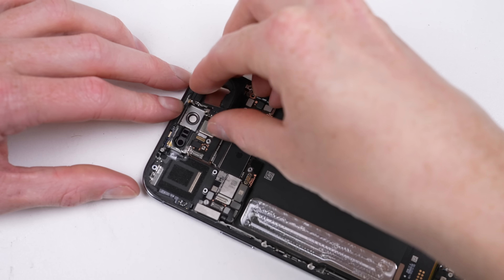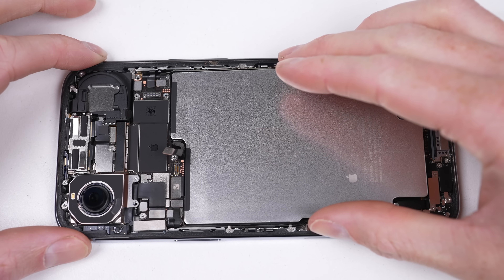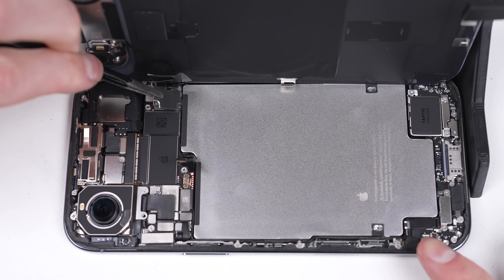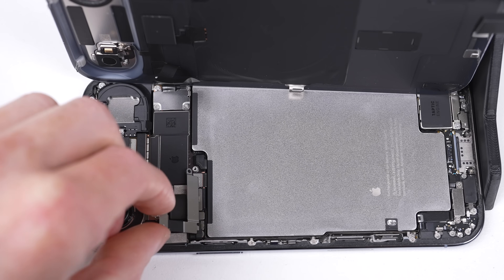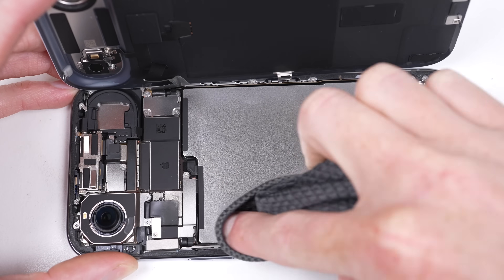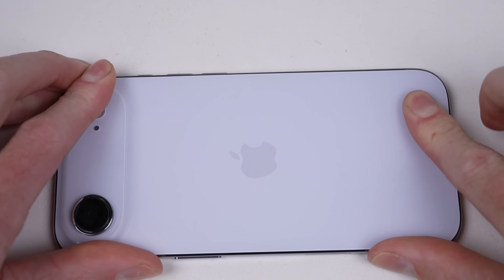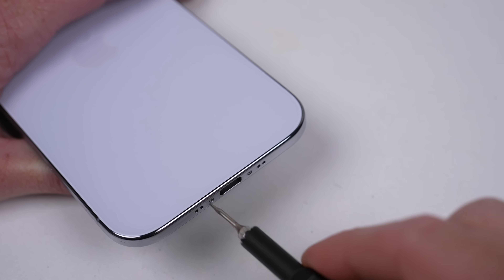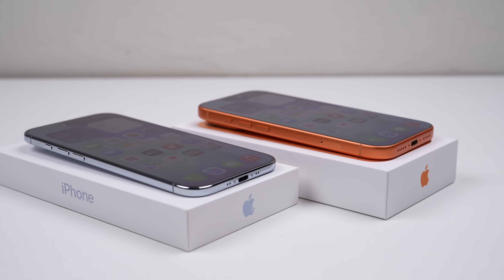With the 17 Pro back together, all that's left is the iPhone Air. I will have to open both of these phones back up to apply some new adhesive when it becomes available on the market. I'll also need to install a new Taptic engine into this iPhone Air to bring it back into a fully functional state. Once the back panel has been attached, I can clean off the insides before closing up. Finally, I can install the two pentalobe screws — and we're done. The iPhone Air and 17 Pro have survived the teardown and repair assessment.